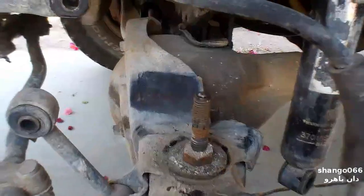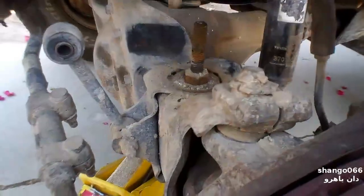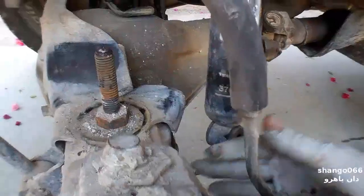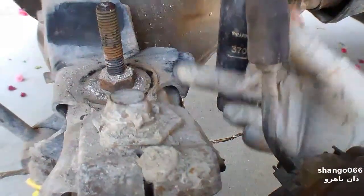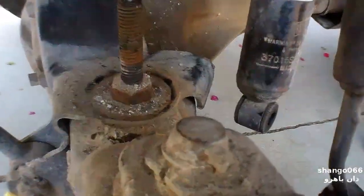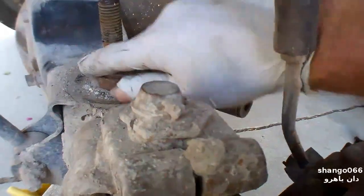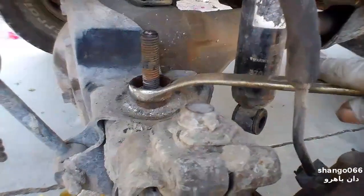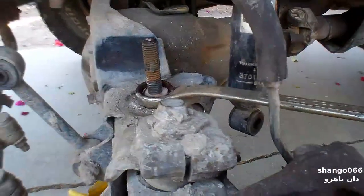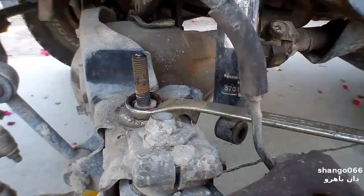It just keeps going. It's actually not a bolt that goes all the way through because of the drive shaft — I didn't even think about that. I believe it's got two nuts welded on the inside of the differential. Hopefully this is all one piece, which I think it is, and then this should back out. This would sure be easy with a big impact wrench.